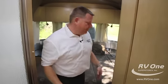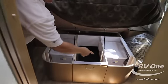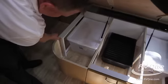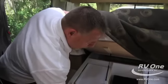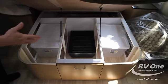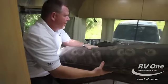If you really want to tell how a travel trailer is built, pick up the bed — that'll tell you everything you need to know. You can see how all this wood is curved, it's all screwed with dowel pocket screws and glue. There's no press board, no particle board, and no staples — that's one thing you'll never find in an Airstream. That's the main feature to show how any travel trailer is built.